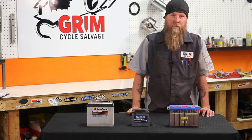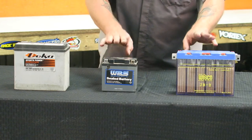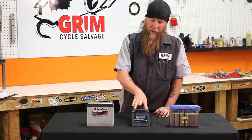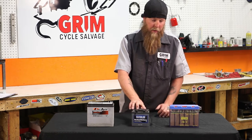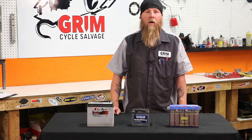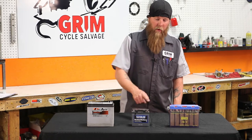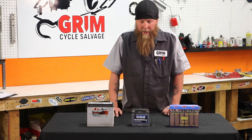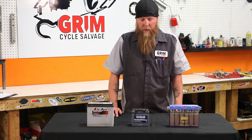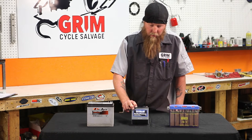Definitely don't recommend putting one of these in your Harley. The next in line is your maintenance free battery. Like the lead acid battery, they come dry — typically with a pack of acid that you pop on top. After the acid drains in, you seal them up and they'll need to be charged. You want to charge both of these batteries 24 hours on a low amperage charger to make sure they get full battery voltage before you use them. The maintenance free batteries have a little higher cold cranking amps and there's no maintenance as far as having to fill electrolyte.